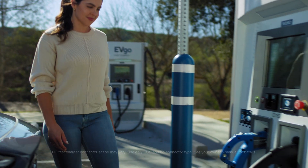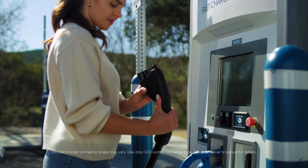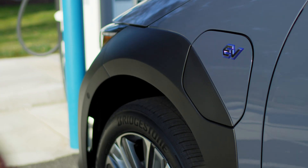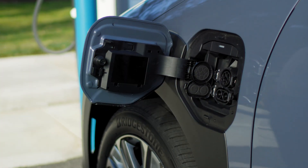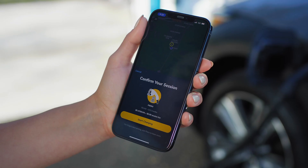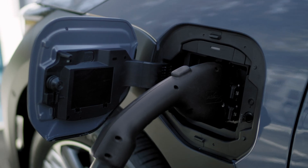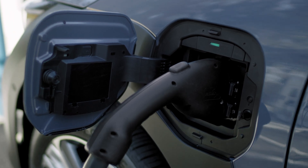When you're ready to get started with a DC fast charger, first check the charging connector for possible damage and follow any instructions provided by the charging station. Open the charge port door and both the upper and lower connection caps. Insert the connector straight into the charging inlets. Then use the EVGO app to begin charging. After a quick system check, the connector will lock into place and the charging indicator light will illuminate.